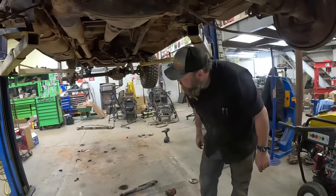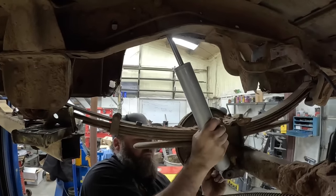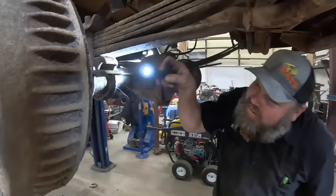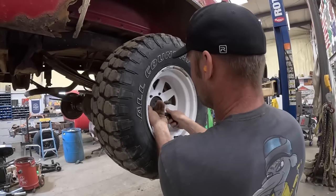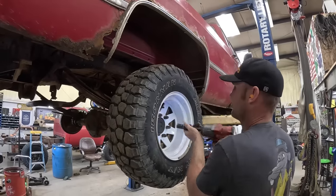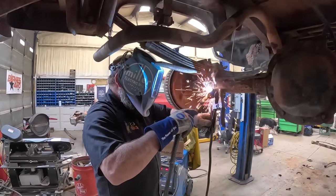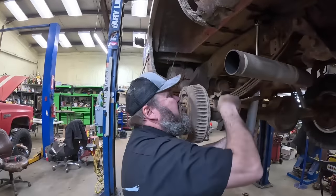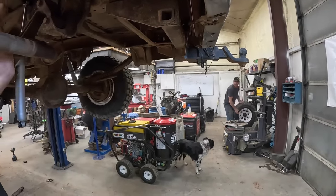See if this shock's any good — there's some, yeah, no shock. Well, one more shock just the other side, then wheels. All right, so here's what we got — the shock is about to exit the rear end, it's got broken tabs both sides so we'll weld it up. Getting closer, got one more tire to change and then we can set it down, see if it sets level.